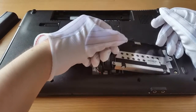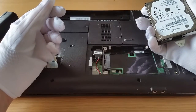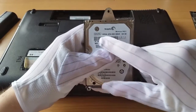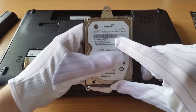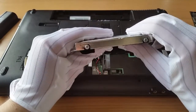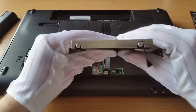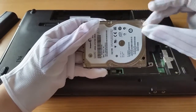Take the same tab and slowly pull it out like that, and there you go. You'll find your relevant hard drive information there — this one is a SATA, 160 gigs, and you'll find your serial number there. Your hard disk drive will be situated in a caddy like this. Take that screw out, that screw out, and that screw out, and it'll just slide out that way.